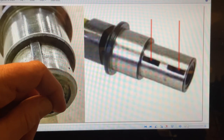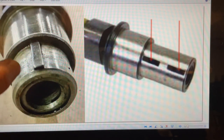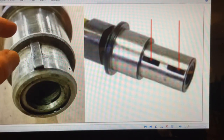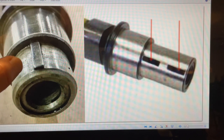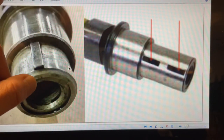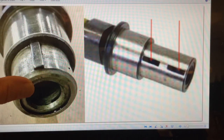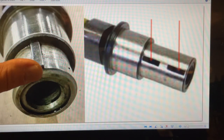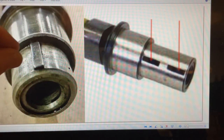I'd also check the actual clearance and whether we need larger shims on each valve with that tester. I have some shims here and would have to order others. When I did the chain, I took all the lifters out and checked them — they have virtually no wear and will last a while. They're original Mercedes-Benz hydraulic lifters. All the plates are the same, which tells me the heads probably don't have 333,000 miles on them — they likely had a head job done with new intake and exhaust valves, all set up exactly because each shim plate is the same.